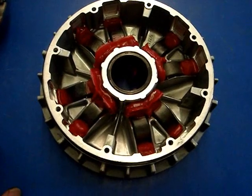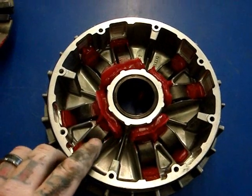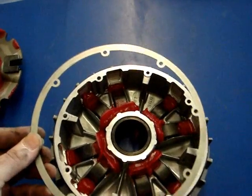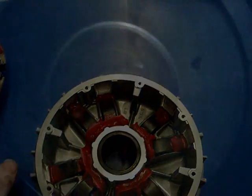On the 660 model, we've already greased our primary sheave as well as installed the lighter weights into the factory Teflon covers. Also on the 660 model, we give you a supplied spacer ring that goes on top of your primary clutch in between the clutch and the clutch cap. Before installing a secondary spring as well.